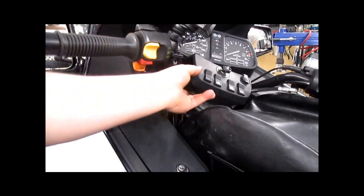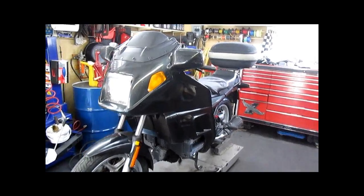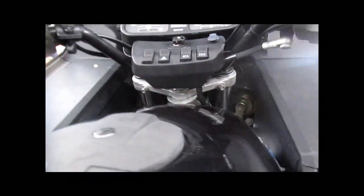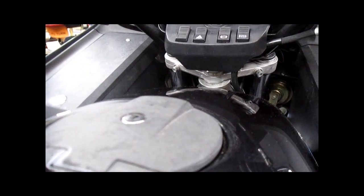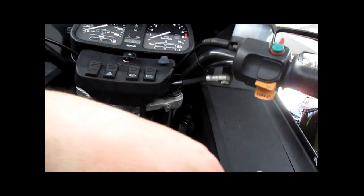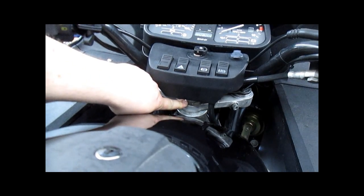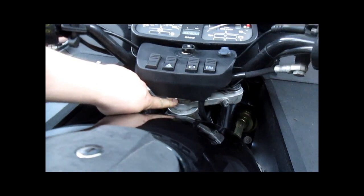Yeah, you can get that with a box end wrench from the side. Our head bearings are torqued now. The upper triple clamp pinch bolts were torqued 19 to 23 newton meters. Did you torque the center nut on the steering stem? What would that call for? 40 newton meters.